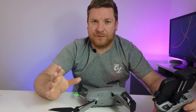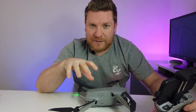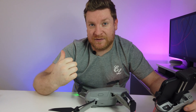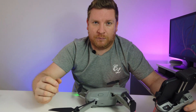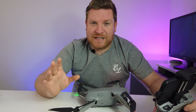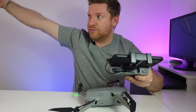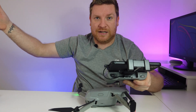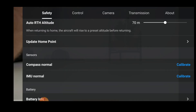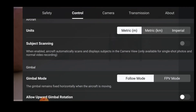Compass is a quite polarizing topic - loads of people have had problems with their compass on DJI drones. In the flight screen there is a little compass icon you can check. If the direction indicator is wrong - say the arrow says you're pointing straight but the drone is actually showing a different direction - go to Compass and calibrate it. That generally fixes the issue.